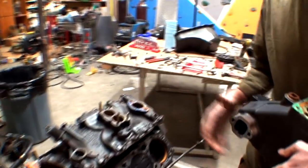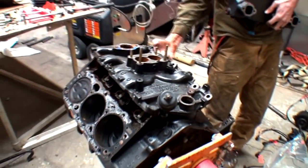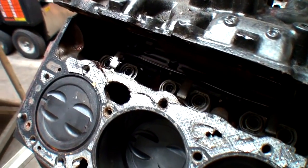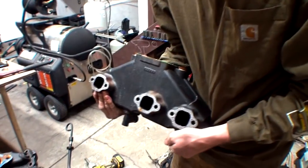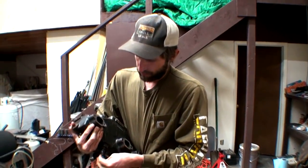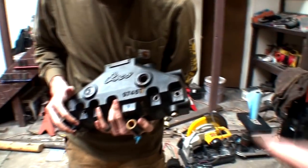The coolant goes out right here where the thermostat is. The water goes down into the heads and down into the block - and that's where it cracked. It froze up in the wintertime. When you say winterize, it's simply draining the water out. On the bottom of these you just have a little drain plug - that's all you have to do. Pull both those out, make sure it's drained, and usually leave them out until next year, taped to the throttle.